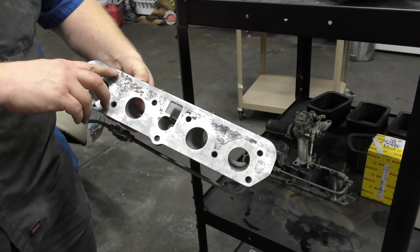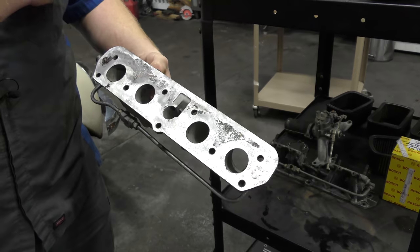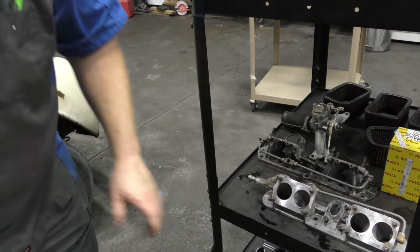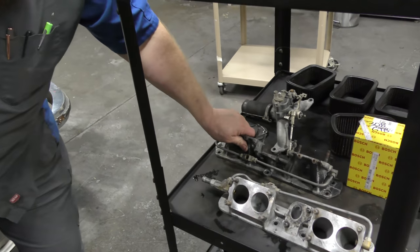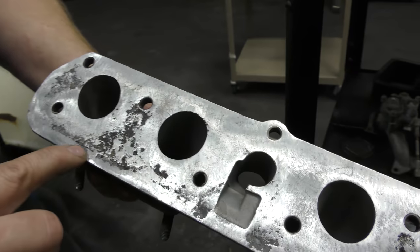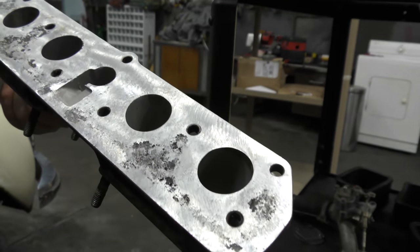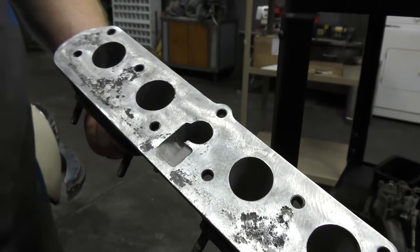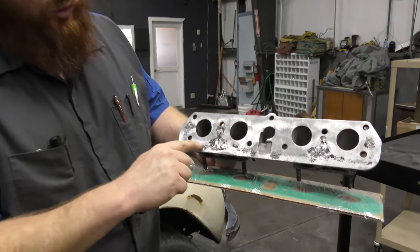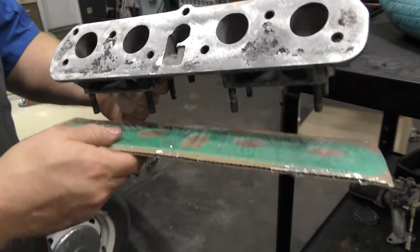You can see that although they put new gaskets on for Car Trek, they didn't hold because of the corrosion. So they used blobs of silicone to seal it up so they could film. I do not want to put blobs of silicone - I'd like to do it right. You can see on the sealing surface there's a little bit there. As you can see where it would try to seal, the coolant could escape underneath the gasket and get out anyway. So we'll get that fixed up.